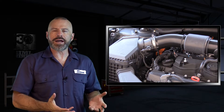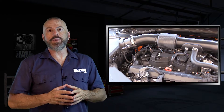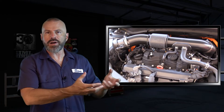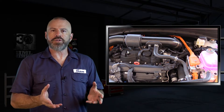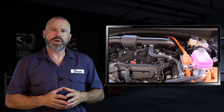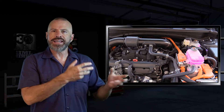Pretty simple for a hybrid vehicle — very conventional in a lot of its makeup and maintenance. The main thing is the fact that you're not going to find a conventional 12-volt battery anywhere in this vehicle. It's all part of a combined battery pack assembly under that rear seat. There is a jumping post there, so you can jump other vehicles if you need to. But there's a process for actually dealing with that battery that you really need to check in your owner's manual to get a handle on.